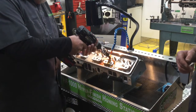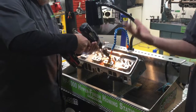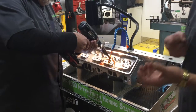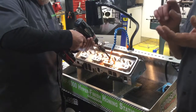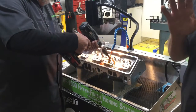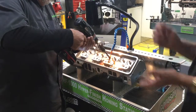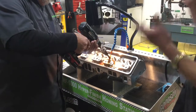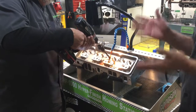I'm going to ask Paul to go ahead and start honing on this valve guide. As you can see, we're using just a battery-powered pistol grip drill — you can run an air drill if you like, but a lightweight battery-powered drill lets you feel what this diamond hone is doing. I want you to be able to feel that, because when you're chasing those final couple of tenths to get that guide on size, perfectly round and perfectly straight, you'll want to feel the tool all the way around. You can't eliminate the need to run your dial bore gauge — you have the same responsibility in the valve guide bore as you do in a cylinder bore: round, straight, on size. And with the Black Diamond hyperfinish valve guide sizing system, available only from Goodson, you can accomplish that day in and day out.